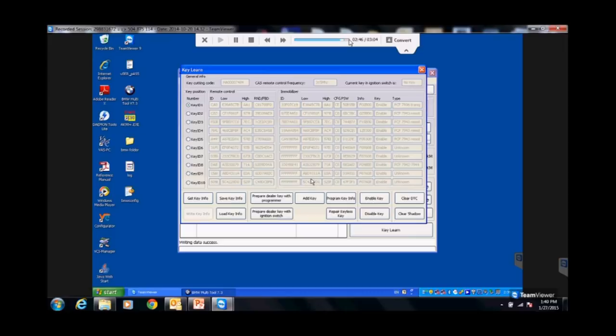Then you start with the transponder. What does it have, key lift? No, it doesn't have key lift. What's key lift? I'm going to go over that in a minute. Again, you'll understand it in a minute. That's why I don't like doing it during this, because it's not something we need to talk about at the moment. We're just doing the simple steps of programming a key. Read the data, wrote the key, I'm going to write the key back to the car. Make sense? Very simple.